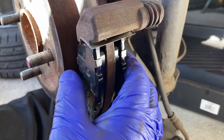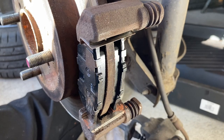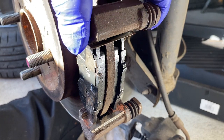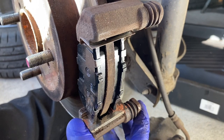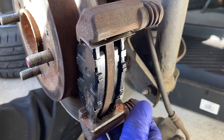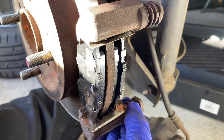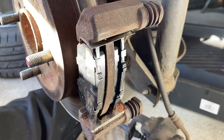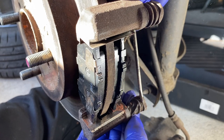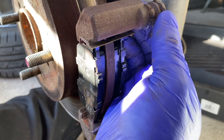We've cleaned off, fitted the new pads, and wound the caliper piston back. I nearly forgot the sliders — this bottom one is very stiff, it barely springs back. So we'll give it a force. We've got a bit of movement there, but a stiff slider can cause a dragging brake, so it's important that you do this. Just unhook the rubber boot — don't split it — unhook it from there and then pull out the slider pin. Same with the top one; that one's quite free, but the bottom one wasn't.